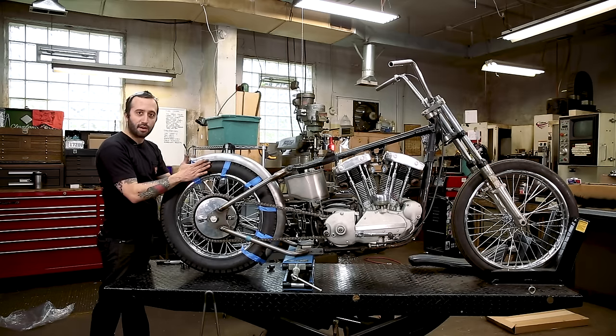Something's going on. One of these is pinching in. I'm just gonna straighten it out here. The width still looks good. It's good to keep adjusting everything as you're going. This is gonna get harder to fit up or move around the more tacks you get on everything, but it still can move around pretty easy. And I'm just kind of tweaking stuff and moving stuff around and tacking and just making sure this still remains square as I go.